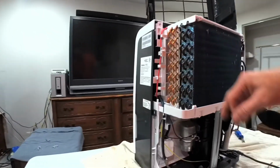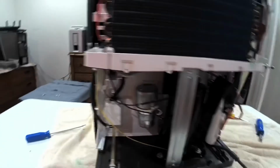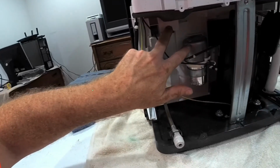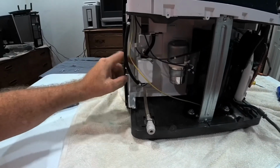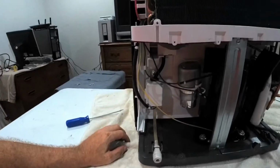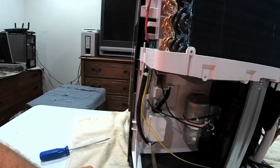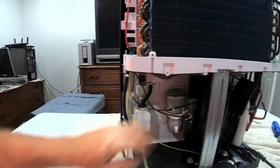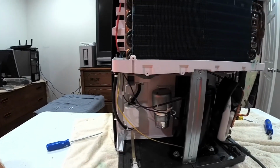The pump works good. Usually if the pump doesn't work, it has a plug in right up in here, where I hope you can see that. Right up in here is where the water comes out of its tray and into this pump area, which fills up the, I guess you'd call it, the bucket or the water tray. And then it hooks into a line here, which pumps out into your sump pump hole or wherever you do it.